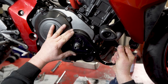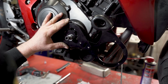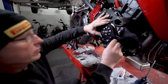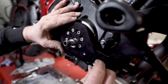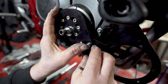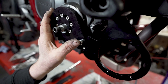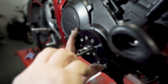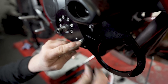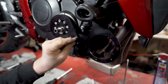And to make sure we've got full adjustment on this supercharger bracket, make sure it stays central on the slot through there. Then we can fit 6 bolts in. I've managed to find a position where I can get 6 bolts in and also see daylight through there to get the adjuster bolt in, and also that plate still floats around so we know it's central. Just centralise it, then just nip the bolts up. We can still get the adjuster bolt through, so that falls in and out okay, and we get full adjustment on the supercharger belt when it's fitted. So I'm happy with that.